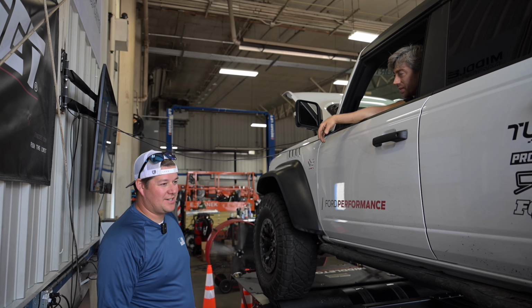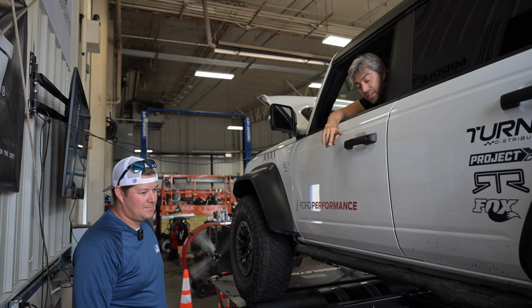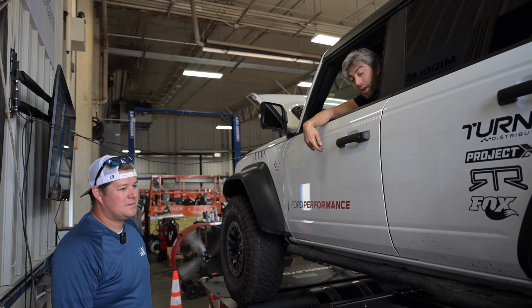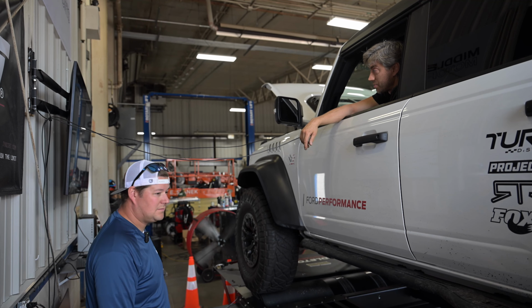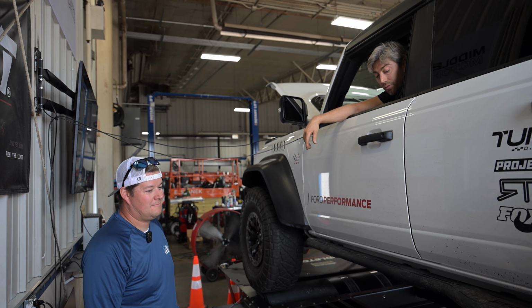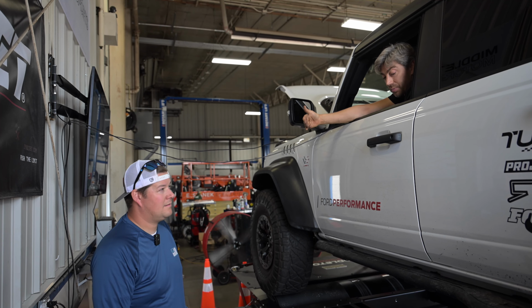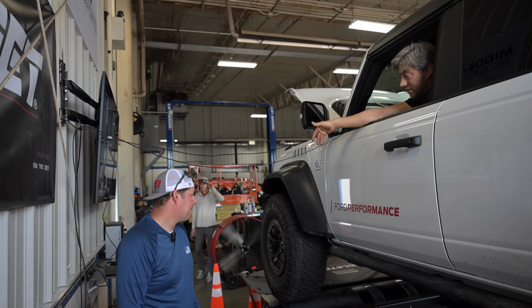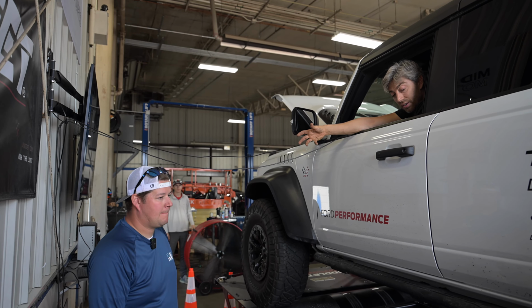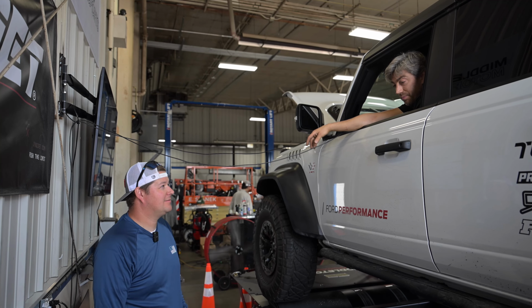These wheels and tires are like 100-some pounds a piece. So normally with big tires like this, I'm surprised, this being rated at 418, that it made this much, especially all-wheel drive. But I mean, Ford might underrate it a little bit. The 10-speeds are pretty good at parasitic loss, but with big tires like this, big lugs on the tires, there's usually a lot of friction on those rollers. These tires are in really nice shape, though. I'm sure that's not hurting. Oh yeah, they're great. I don't know what happened.